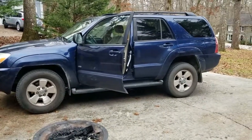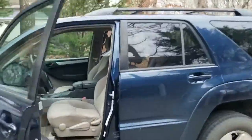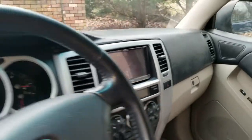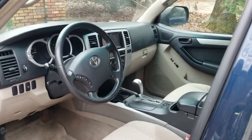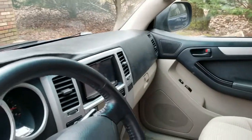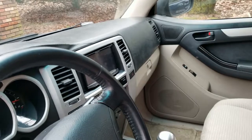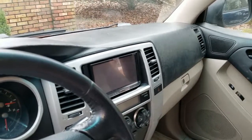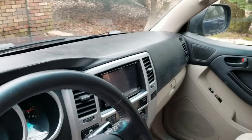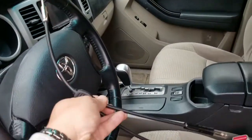Today we have a 2005 Toyota 4Runner. A little while ago I upgraded the radio and put in a really cool Pioneer digital radio. One thing I found out after finishing the install is that the 4Runner actually has two antenna connectors — one for FM and one for AM radio. The FM radio did not pick up well before, and that's really one of the reasons why I tried to change the radio. After I installed it, AM did not come in because there was no plug in the back for it.